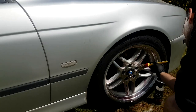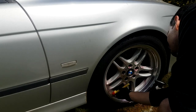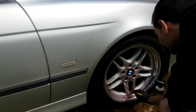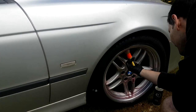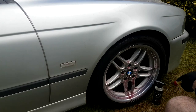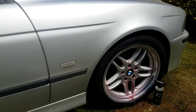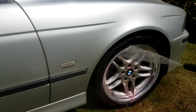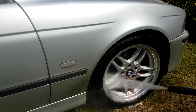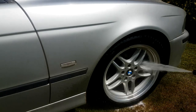On the other side of the car I'm just going to work through with the detailing brush to agitate the iron remover into extra areas it may not have got into, but also to try and disturb out some of the dissolved particulates to see if we can get them removed from the surface. Now we just allow it to sit for a while longer now that it's been agitated, and then after that I'm just going to rinse it away.